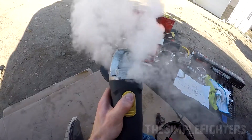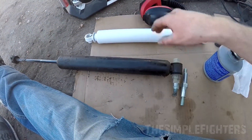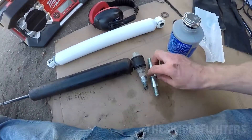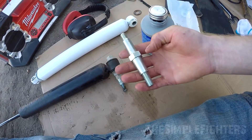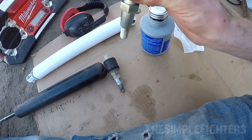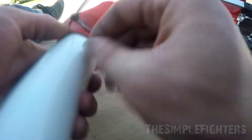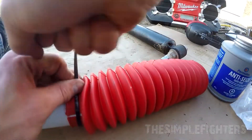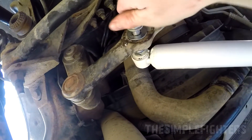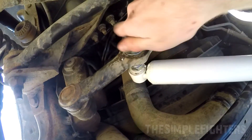I think I'm going to have to grind this off because I bent it from hammering. Here's the old one and here's the new one. I'm going to apply anti-seize inside and on this as well so it doesn't get seized up again. Mine wasn't that bad but they can get bad, so I'm going to save either myself or the next guy. Be the nice guy — anti-seize it. Stick it on this side first with the washer.